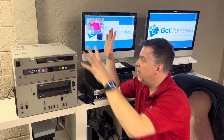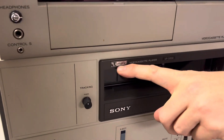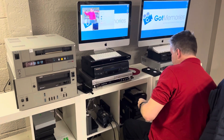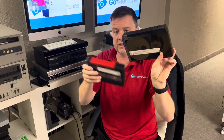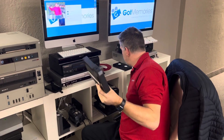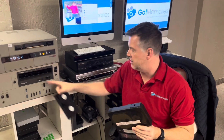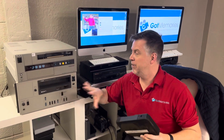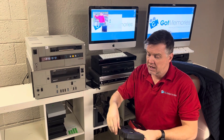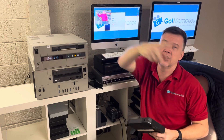Now, again, if you're looking to do this yourself — buyer beware with all of these units. This is a three-quarter inch U-matic — this particular format here. This is another professional format that was used in the late 70s into the early 90s. Here are U-matic tapes — you've got your 30-minute and your 60-minute, and here's a VHS tape for reference on sizes. With these players, they're abundant — you find them everywhere — but none of them work. These models need constant cleaning of the heads because tape particles over time clog up the audio and video heads and they need to be constantly maintained.